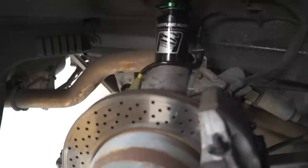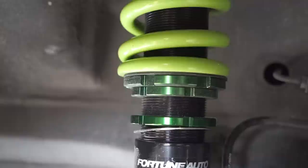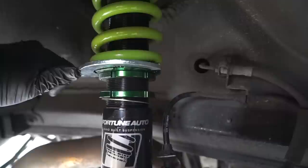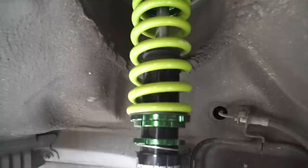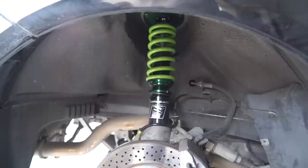Yesterday towards the end we tried to lower the coilovers, and I've been sitting here trying to figure it out. For some reason, I still can't really get the whole coilover assembly to go down into the collar of the coil. I went ahead and put some grease on these little perches right here just so we could try and get into the collar better. But the problem is it's really, really hard to get the black piece — the perch piece — to move down into this. Watch: I'm trying to move it down and the whole thing moves, right? It'll get stuck right about here, and then the top just moves by itself, and I don't want that. I'm just going to be changing the preload of the coilover, and that's kind of a bummer. I'm going to sit here and try and figure out how in the world I'm going to be able to move this up and down.